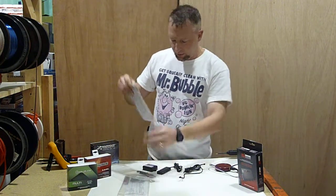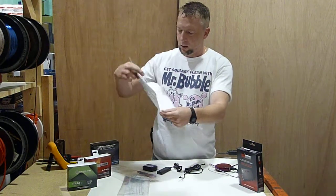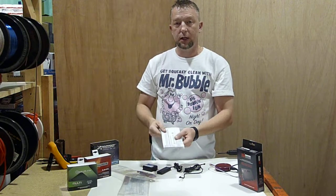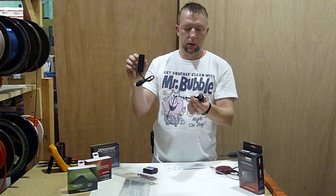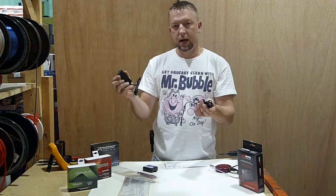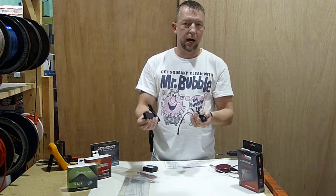All of these bypasses come equipped with standard firmware. Say for instance you've got this one here — this is an IBH34, which is a Honda or Acura bypass. It shows a long list of different vehicles it can work for. Now if you buy it, get it mailed to you, and realize it's not going to work for your application, and you don't have the loader — which is this guy, the ADS USB, also called an Omega Link OL loader — instead of spending 50 bucks to use it for one shot and then having a piece of junk you'll never use again, you can give us five bucks and we'll do the service for you: install the firmware and send you the PDF telling you how to wire the module up.